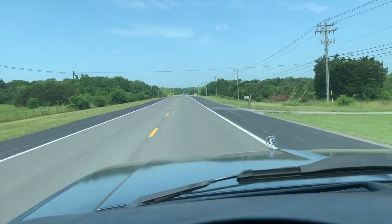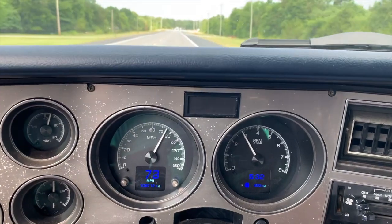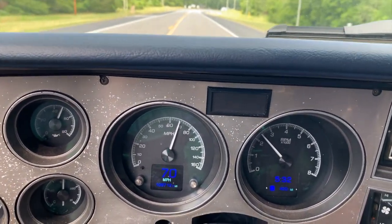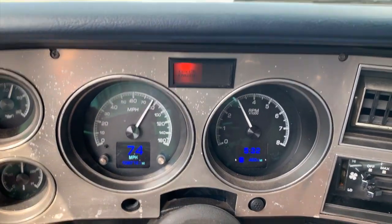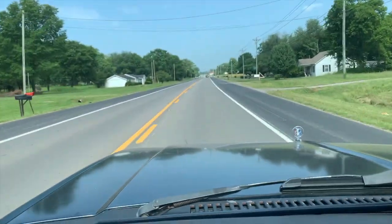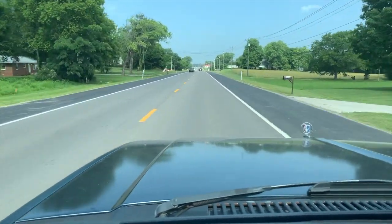Now imagine if I floored it right now, that high stall should come back on. We'll find out. Maybe it's not. Oh, maybe it's because of this. There we go. And that was because of the kickdown, I'm sure of it. Let's see if I can get it to do it again. All right. Pretty neat stuff. 1967 GM technology. What would you have thought about that?